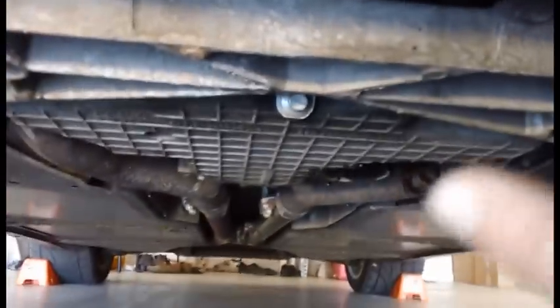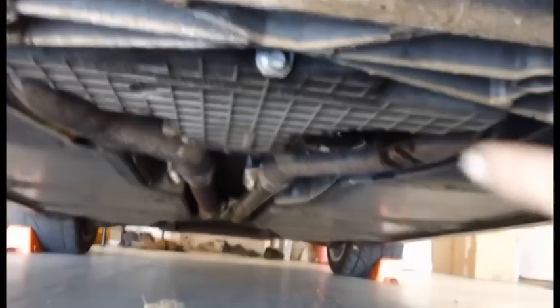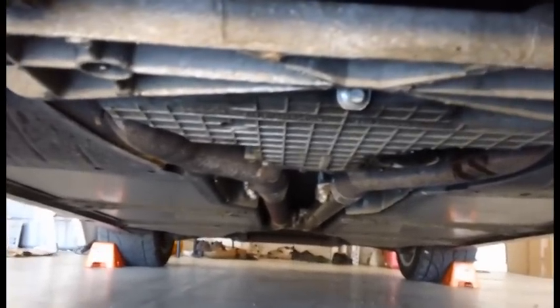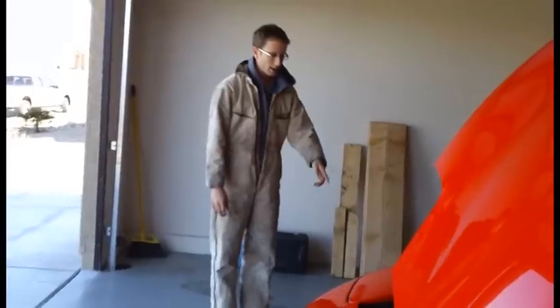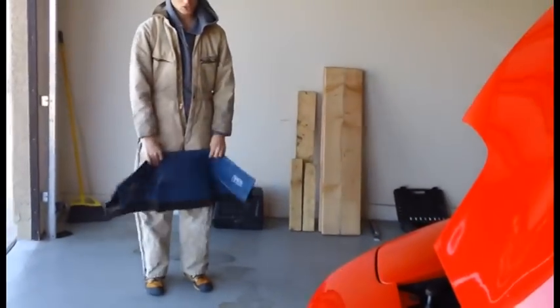When you fire the engine up it'll start pretty quick, and you're going to look at the oil pressure gauge. You can see my oil pressure sending unit isn't exactly accurate, but we are building pressure and things look good. I'm going to look underneath the car — do a visual inspection — and we look good on the drain plug and on the filter. If you don't have things right, oil will be gushing out everywhere right now, because the filter is under pressure. Now I just have to get the car off the jack and ramps, level it out, check everything once more, top off the oil, and that's about all there is to changing the oil in your Corvette.